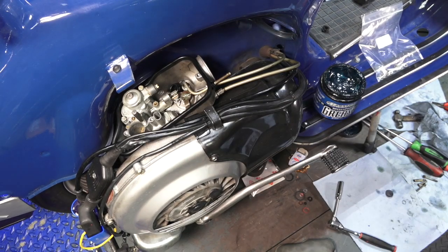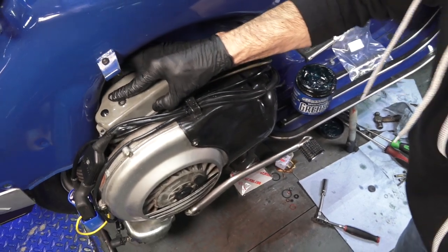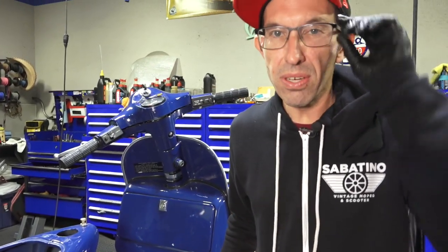That's pretty much it for overhauling the carburetor and oil pump. Next video, part five, we'll overhaul the fuel tank. I hope everybody found this useful, whether you're interested in vintage bikes, found a nice barn find, or want to get one running. You need two things: spark and fuel. If it's been sitting, the carburetor will be gummed up. Amazingly, these vintage Vespa carburetors handle sitting far better than modern ones — I've seen them sit 10 years with old fuel and still start. Check us out at ScooterWest.com for all the parts you'd ever need. This is Robot from Vespa Motorsport — until next time, watch part five.